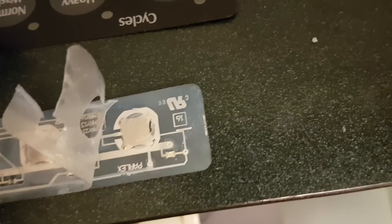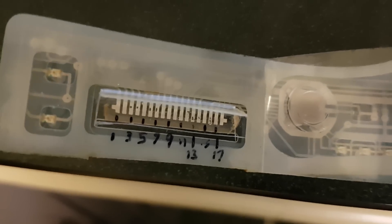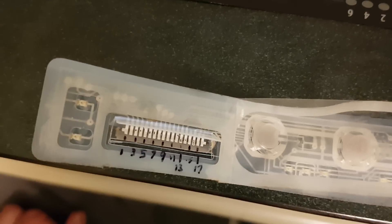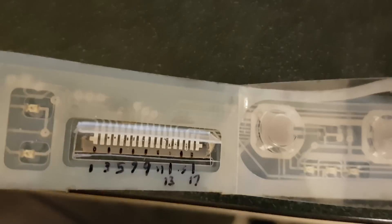The auto clean button is at the far end. To activate auto clean, one side of that button is connected to pin 10 and the underside is connected to pin 5, so there will be a 10k connection between pin 5 and pin 10 when auto clean is pressed. Pin 5 is also used for the heavy wash button — the second button in from the end. To activate heavy wash, you put a 10k ohm resistor and a momentary switch between pin 5 and pin 9, so when you press heavy wash you see 10k between pin 5 and pin 9.